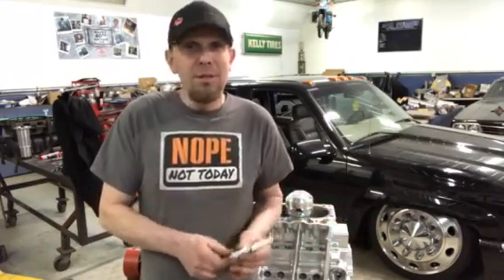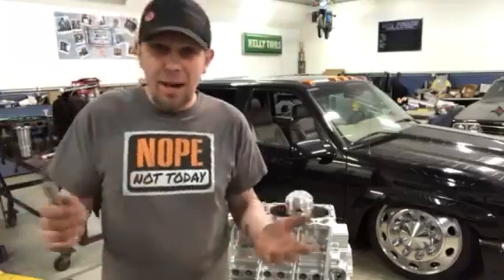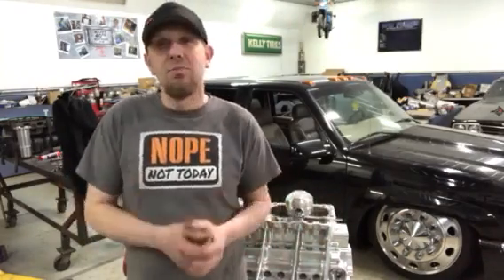It doesn't hurt to take time if you're building your own motor and double-check the machine shop's work. There's nothing wrong with that — make sure that you do it. It's human error; it doesn't mean the machine shop screwed up, it's just something that sometimes happens. A lot of shops are busy. It doesn't hurt to grab calipers, a micrometer, and feeler gauges and go through everything from crank journals to rod journals, even piston-to-wall tolerances. If you build a motor and you know you're going to have large piston-to-wall tolerances, chances are you're going to hear that diesel piston slap clatter. Don't be afraid — a lot of race car motors are set up that way.